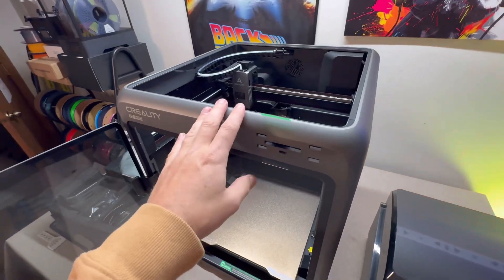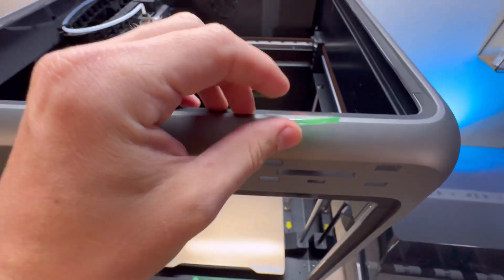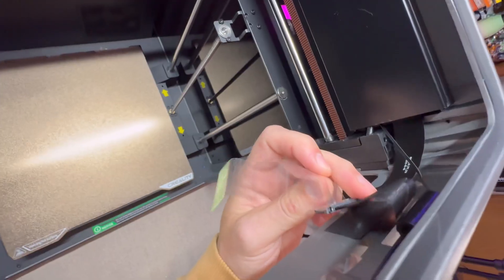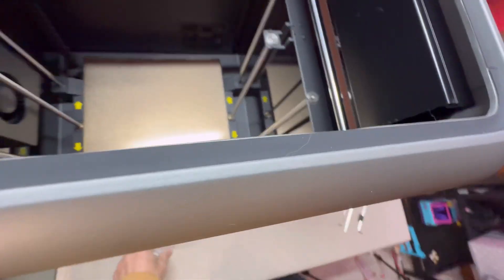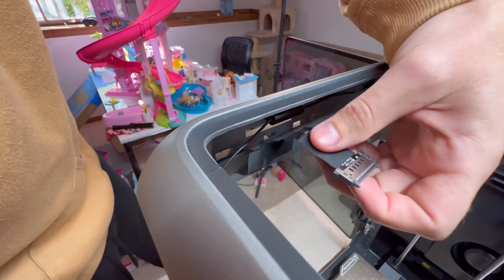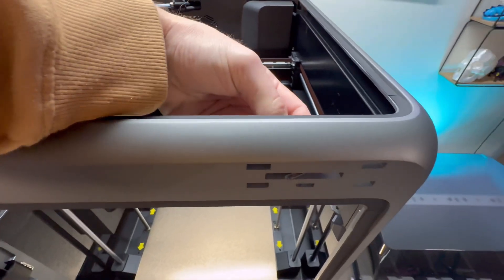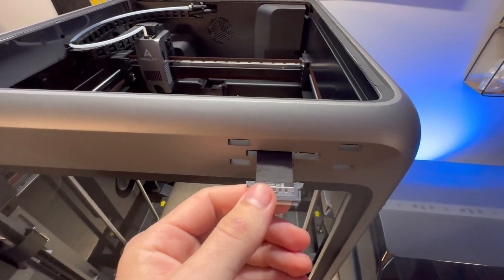Come over to this area — you'll see green tape. Peel it back carefully because there's a ribbon for the display underneath. Gently peel it back, try not to harm the ribbon. Then bend the ribbon this way and poke it through the front hole of this face. Kind of just lightly pull it through.